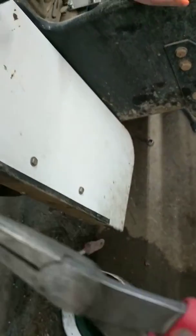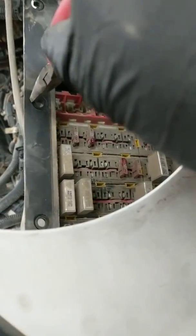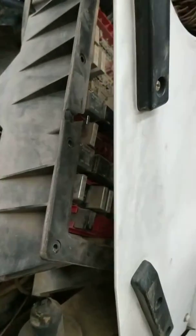That clip there, that clip there — under that relay there's going to be another one up top, and another one in the back corner. Just push those in, squeeze them together with your pliers, and that intersection will pull out of the plastic. Then you'll be able to access the back of it. Hope this helps you guys, thanks.